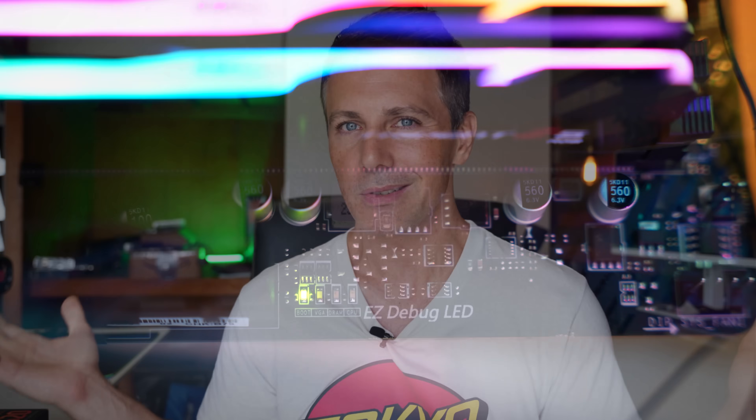That said, this motherboard will work absolutely fine with a Ryzen 5 7500F or one of my favorites, the Ryzen 7 7700, which have default configurations of 65 watts TDP. So if you're going with either of those two CPUs, you should be okay — except keep in mind, as mentioned earlier, you may still have memory compatibility issues that cause your system to not boot at all. It seems like MSI have really dropped the ball on this budget motherboard.